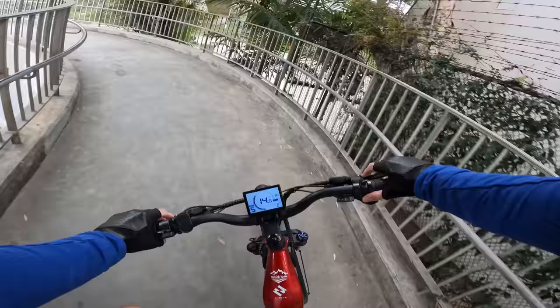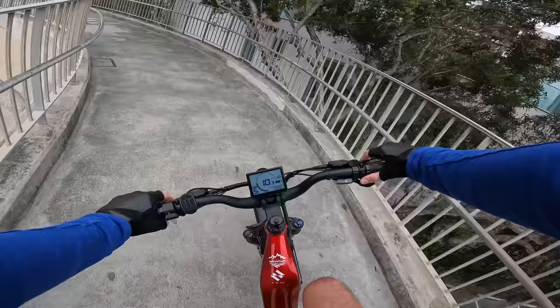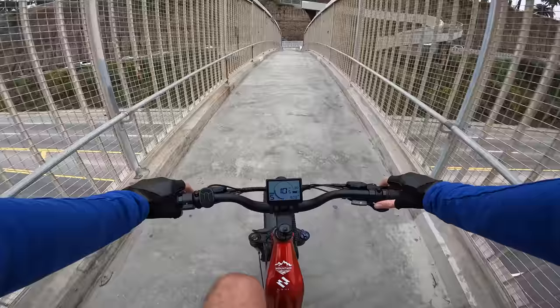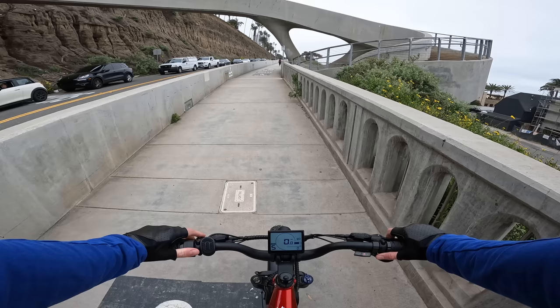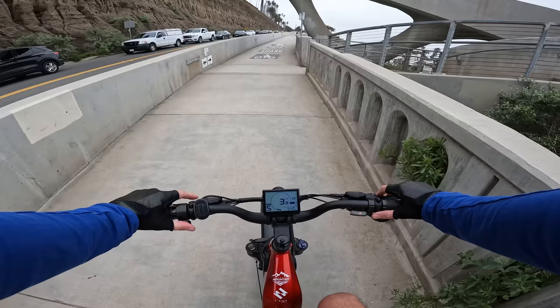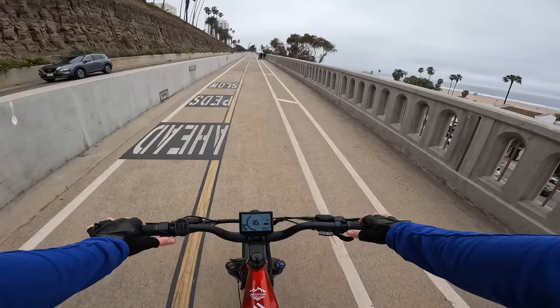Gear shifting has been flawless on this bike. Bumping onto pedal assist 5 and going into the climb, it's giving us a nice 900 watts over the bridge — that was cake. On the California Incline, full throttle, ramping on power: 400, 500, 800, 900 watts. With a little bit of pedaling I wasn't really even helping it, but the motor is outputting 900 watts and just pulling us right up this long gradual hill.